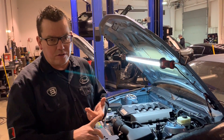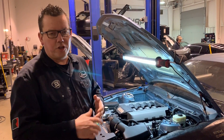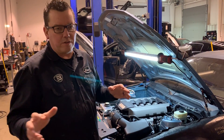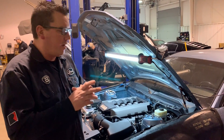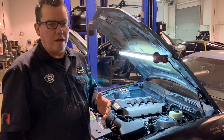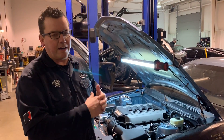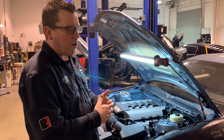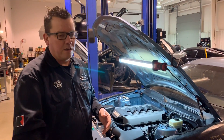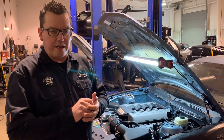You're only going to use two of the three wires. One's a ground. The other is a choice: do you want to activate the two-step with a ground or with power? You can use a button, the clutch switch, relays — however you want to do it. It's very simple. If you drag race on a manual transmission car, you hammer it, your RPMs come up, you dump the clutch at exactly the right RPM. The two-step helps you do that consistently.